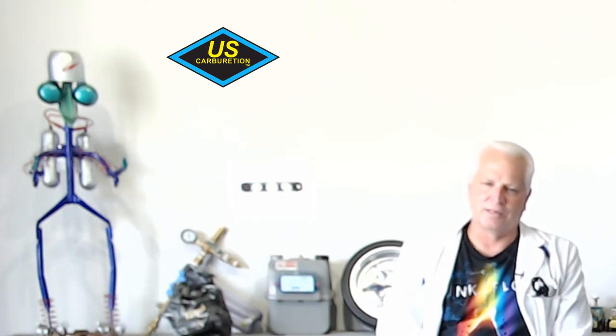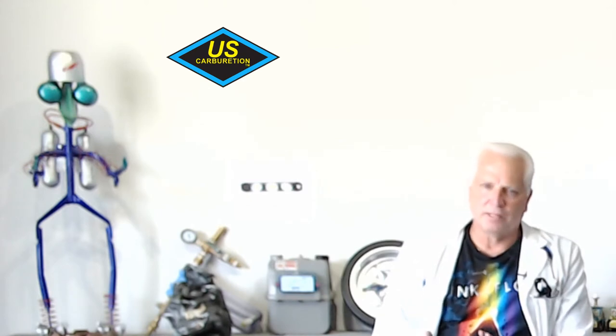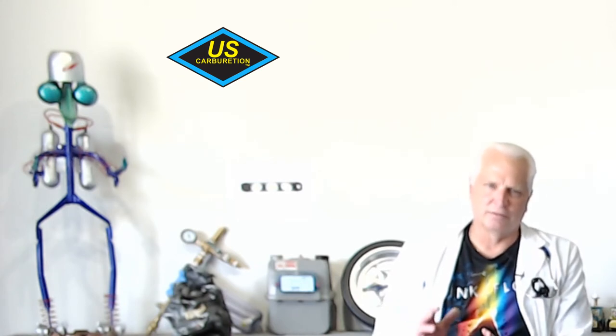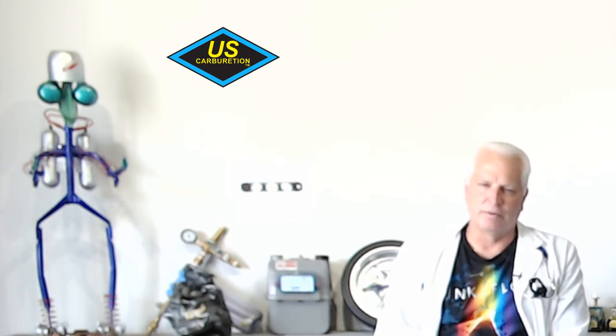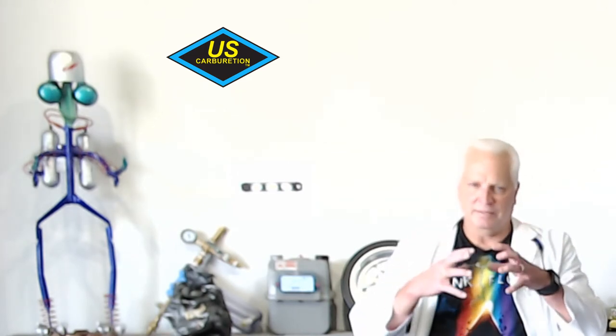Just remember, too, a 20-pound cylinder no longer has 20 pounds of gas in it if you get the exchange. So the fuller they are, the more load they'll carry. You have to remember that too. The fuller the cylinder, the more BTU load they will carry because the gas inside boils and then the ambient heat warms the fuel back up.